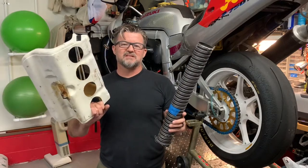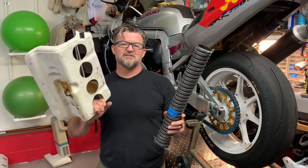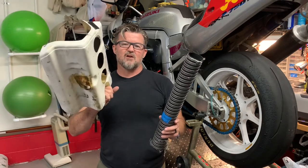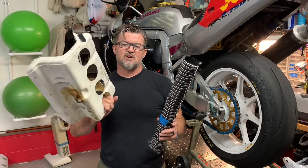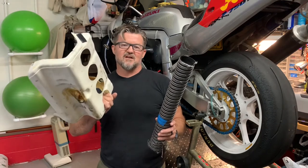Hey everyone, I have a few minutes to get in the garage today while mama and baby girl are at the salon getting their fingers and toes done. We're going to talk about pressurizing your airbox and running forced air. If you don't want to enclose all of the carburetor, this can be used with your OEMs with a jet kit, or you can put in the FCRs or the MJNs — it just makes fitment and some modifications easier.